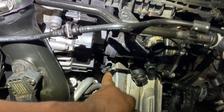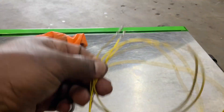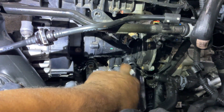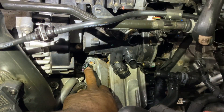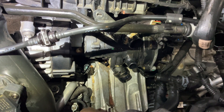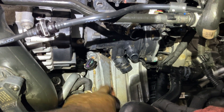You will need a new connector and you've got to re-pin it with new wiring. You're also going to need a thermostat housing. At this point I'll do the thermostat housing and the water pump. See how green it looks — that's corroded, it's shutting out everything. That's why the car's not starting. Voltage reference low — that combination right here, a leaking water pump creating all that corrosion.